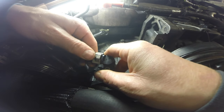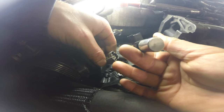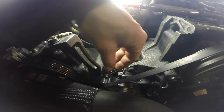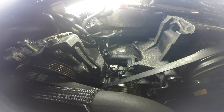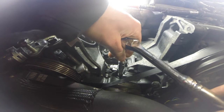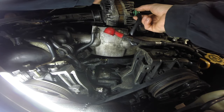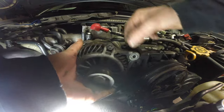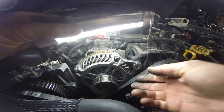Looks like you just push down the tab here. It's a little grimy and crusty in there, so make sure we get a nice clean plug and clean connection. Nice easy swap out. Now let's just put it right back in place, right down in the hole. We're going to put back this 10-millimeter bolt and get it nicely mounted — pretty sure it's as easy as that. Let's torque it down — don't go crazy on it. It's a plastic housing, just tighten it down enough so it won't come loose.